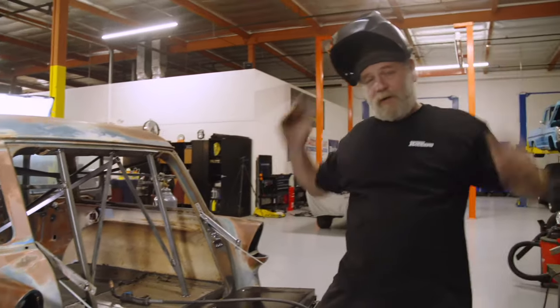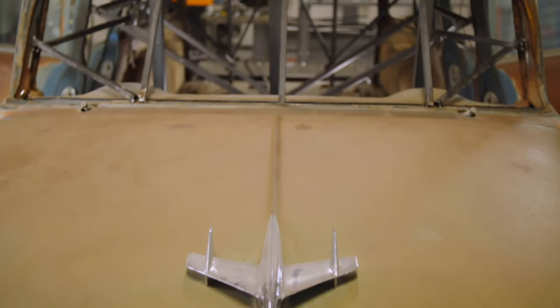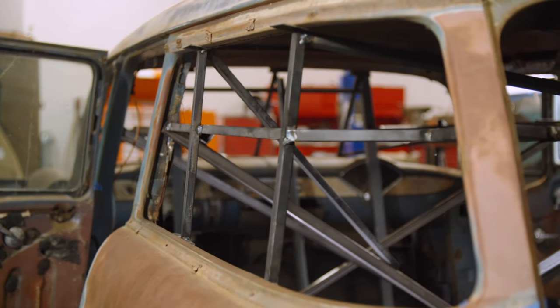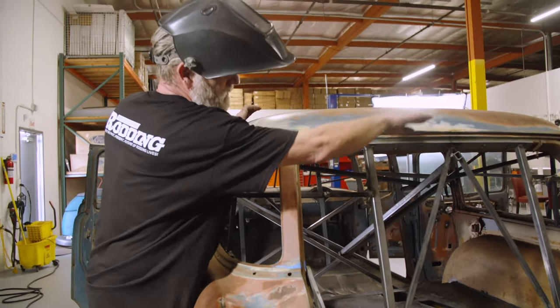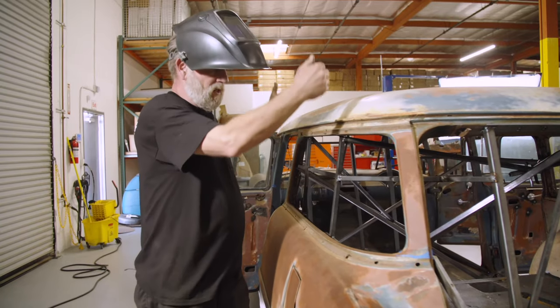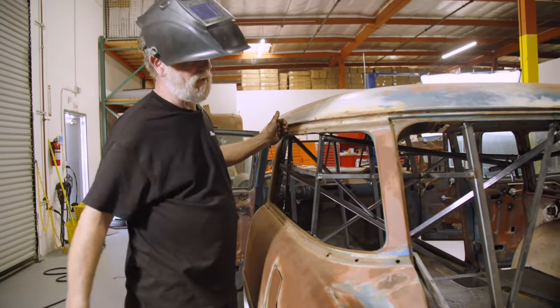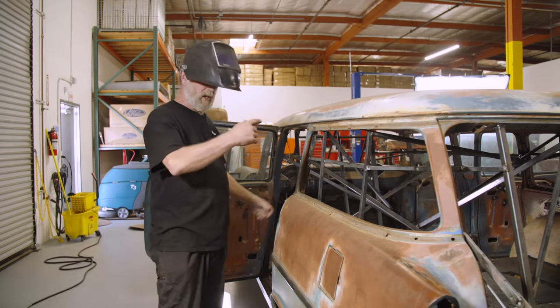So that's our frame finished, and it looks a bit overkill but it does two jobs. One, it's welded to every pillar so the pillars won't move. Secondly, it's got these saddles so the roof sits on here - so when we put the new roof on we know we've got the exact right height and can get the pillars cut in the right place. Now the frame's done, we can start to cut the roof off.